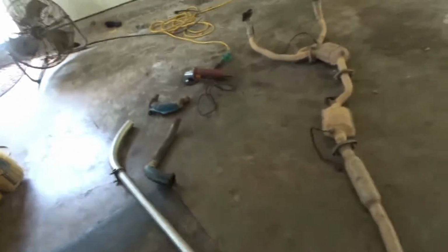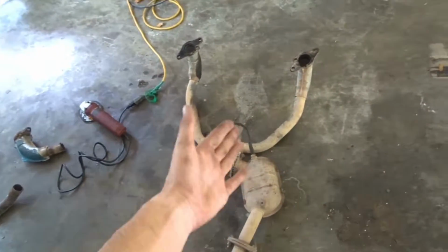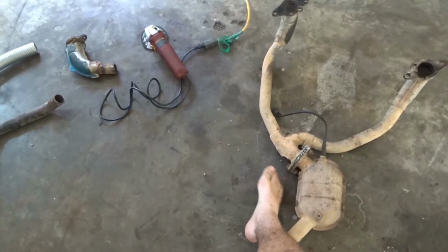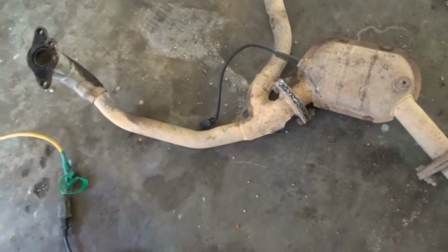Because it's June and that's February, so I've been driving whatever, and now that I got this new engine in, it has no codes except for the P0420 code, which is the catalytic converter code. It's been going off because there's a big gap right there in the catalytic converter flange, so it was all escaping, it was all black and stuff, so I cleaned it up.